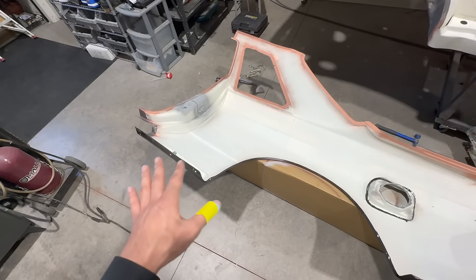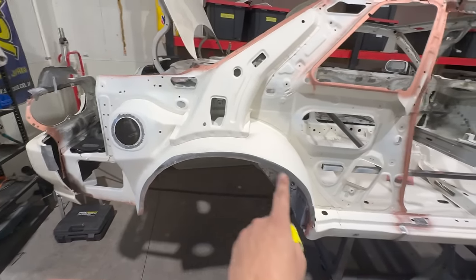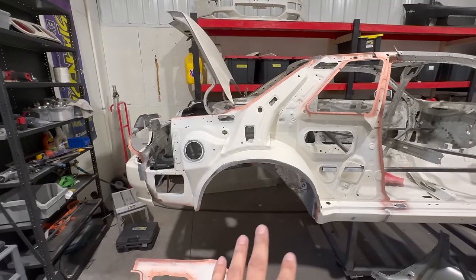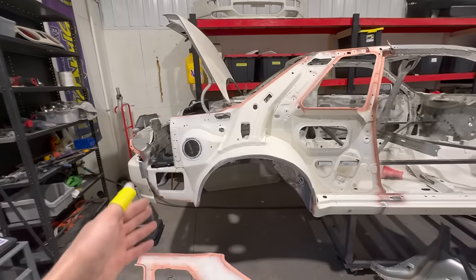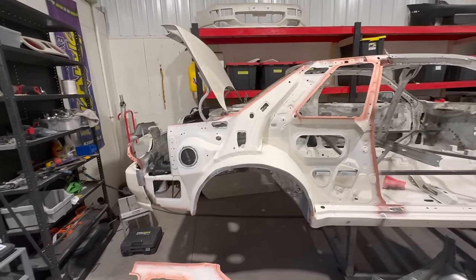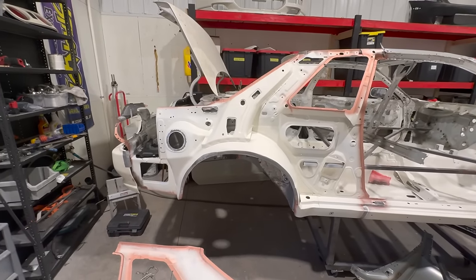Now, guys, this comes to the point where I took a lot of time to figure out how I want to go about this whole installation process and where I want to apply my panel bond. The main obvious one is right here along the arch. Now all of this panel bond stuff is just extra. Some quick info: the average tensile strength of panel bond is about 3,500 to 4,000 PSI. The average tensile strength of a weld is about 2,000 to 3,000. So it just goes to show you how strong this stuff actually is. You don't want to only use it to apply your panels — you obviously want to incorporate welding as well, which we're going to be doing a lot of. It's just an extra layer of strength and rigidity.